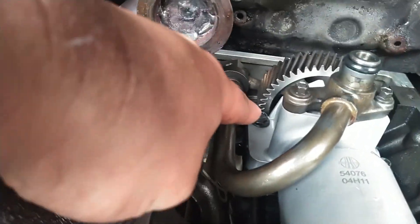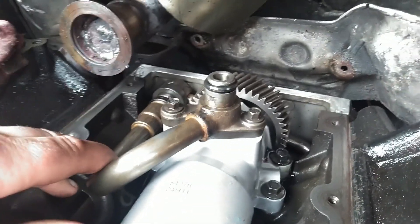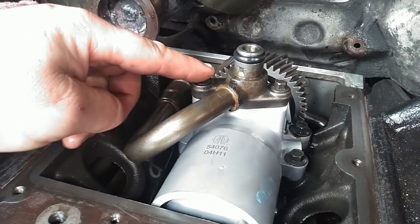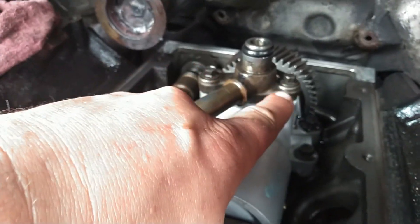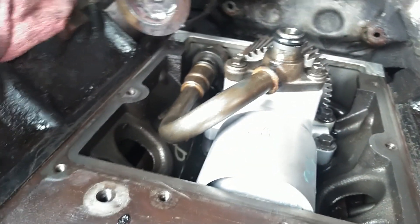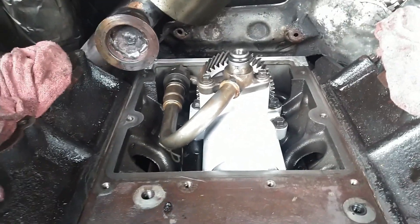The o-rings are installed. As far as mounting the pump, this doesn't have to be timed - it just has to be mounted. The mounting bolts, there's three of them - I torqued those to 20. I torqued these to 12. I think the manual says 18 and 11 maybe, I don't remember, but I've always just done 20 and 12 and never had a problem.